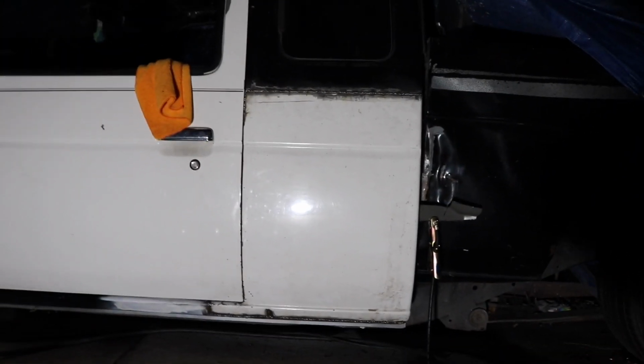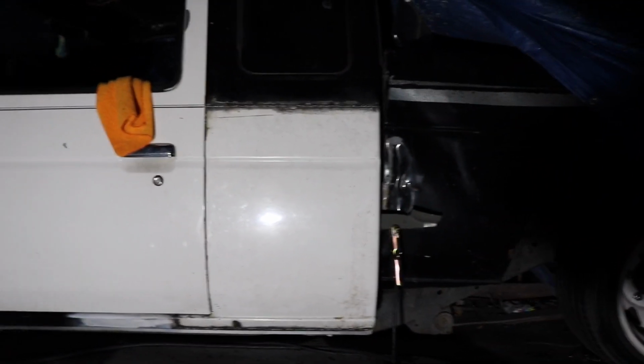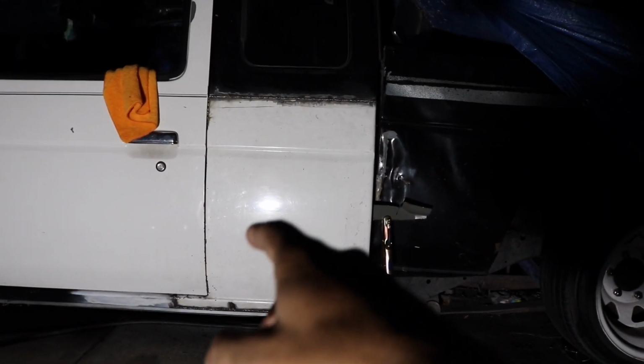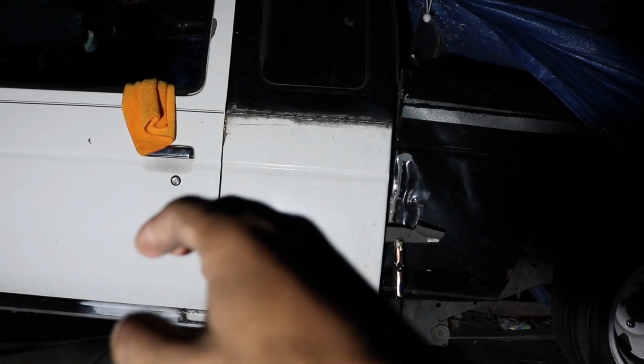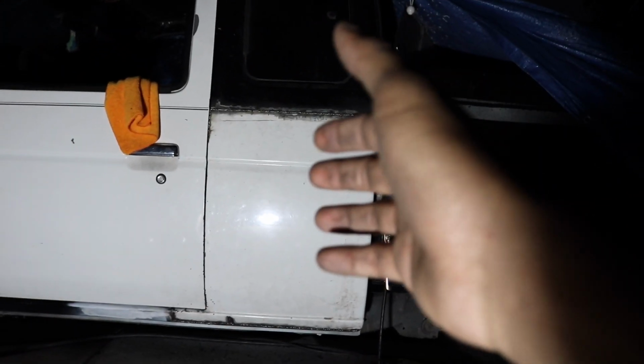It's all welded up. Looks like a 5-year-old welded it, but I can't really do too good of a weld since they're literally just a bunch of tacks. That's essentially all it is. Now the next step is going to be grinding away the welds, and I'm pretty positive there's going to be a few holes because I know there's some spots where I didn't get full penetration. So I'm gonna have to go back and do some more welding on that.